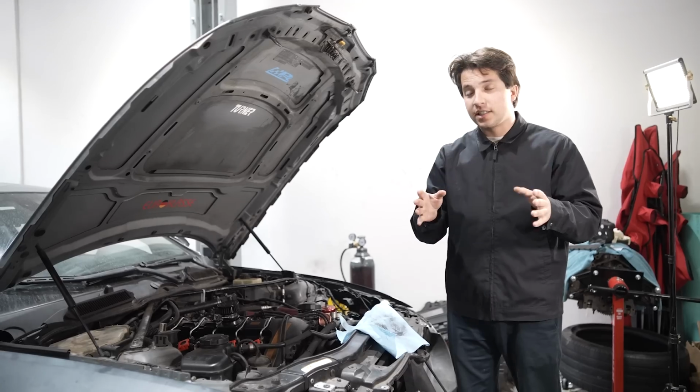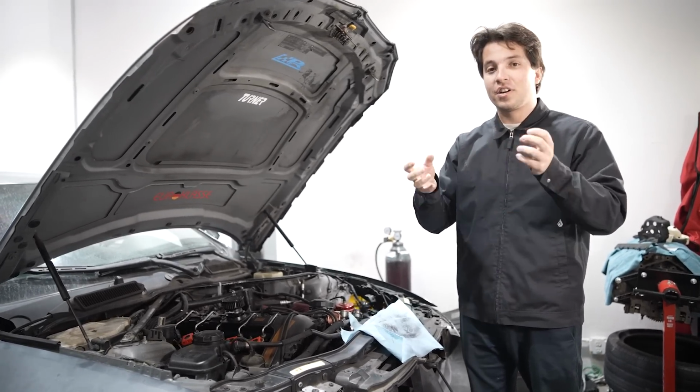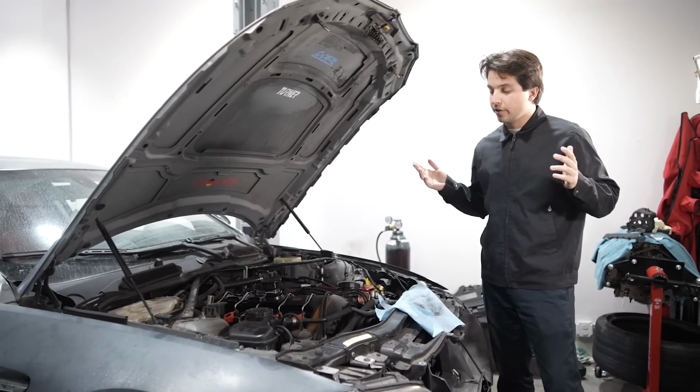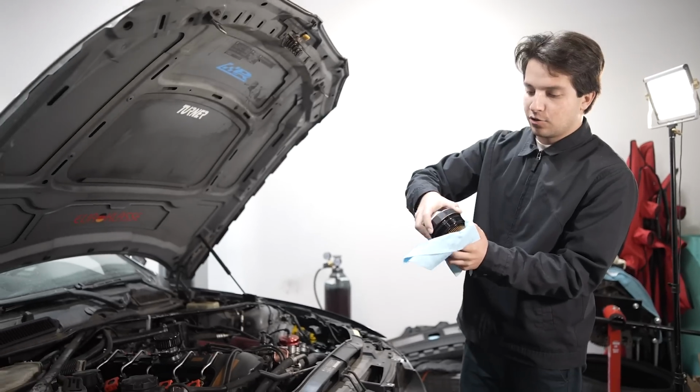In some cases, the injectors can leak gasoline into the cylinder. It'll seep past the rings, wash the wall. Critical oil spots are no longer oiled. Your engine could go kaboom, which is not good. So we need to figure it out.